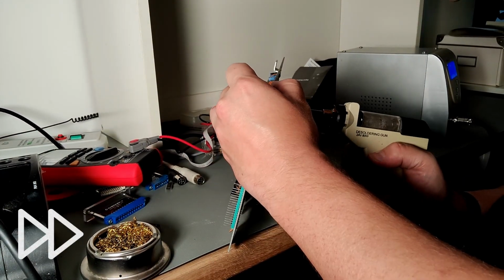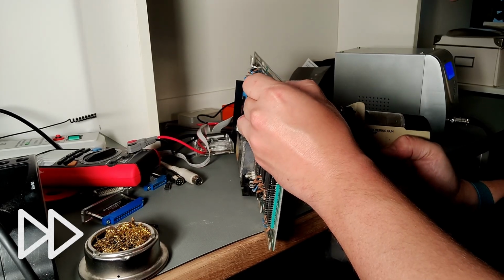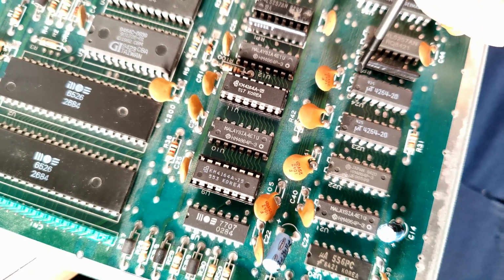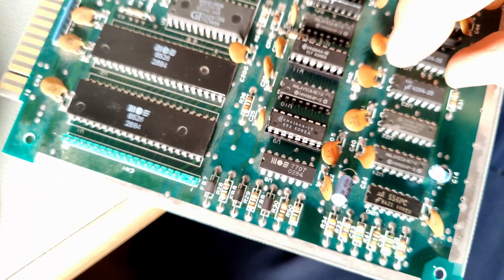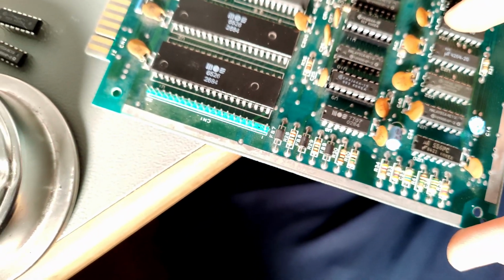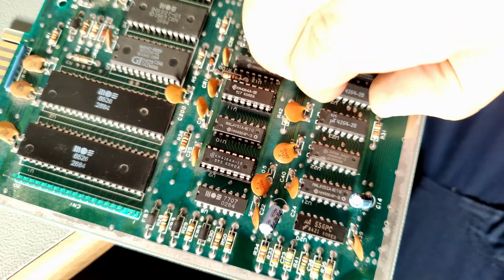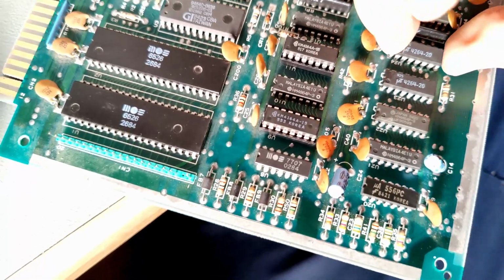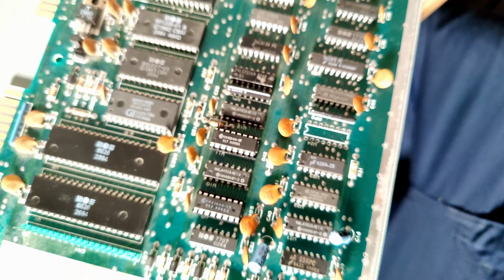And I would say I swap it out now. For desoldering, it is really useful to desolder the whole thing in a circle motion. Then press from the side towards the individual pins so that they get a little bit loosened. Push back and forth a little, to the left and to the right, and then when everything went well, there's a bit of hooking here. Then we can get out the memory totally problem-free. Without a lot of force or something like that.